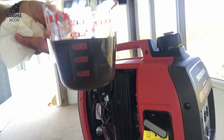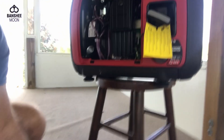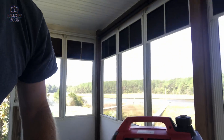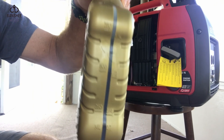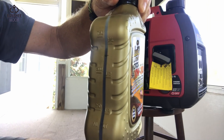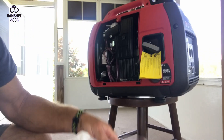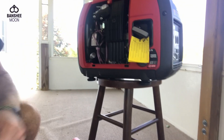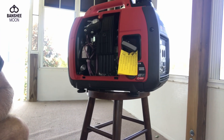But look how dark this oil is. Another thing I find interesting is these units are said to be shipped without oil after manufacture. That was not the case with this unit, because I bought this oil — and look how much I used. I only had to put an ounce or less in this unit. It wouldn't fit anymore. So apparently it was shipped with oil in it, and that can be pretty bad, because you don't want oil to foul up your spark plug or get into your carburetor.